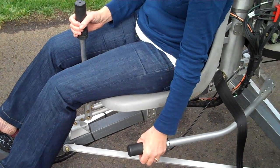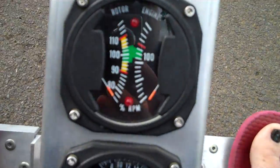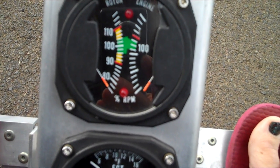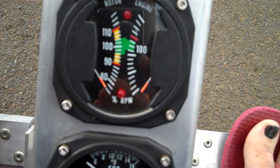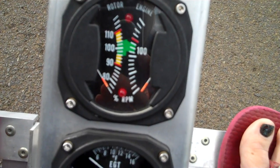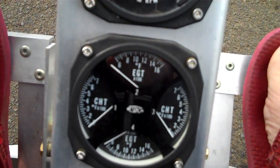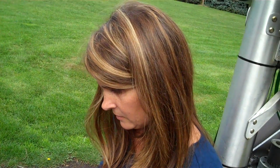I hope you recheck all this before you take off. Notice these two little gauges right here — it's got a needle on either side. The left-hand one is for your rotor speed and the right one is for your engine RPM. You have to keep those needles in that green arc all the time, and it's a chore. As you do anything, it's going to change a little bit. You've also got temperature gauges and your airspeed indicator, but I can't see it unless I lean my head way over.